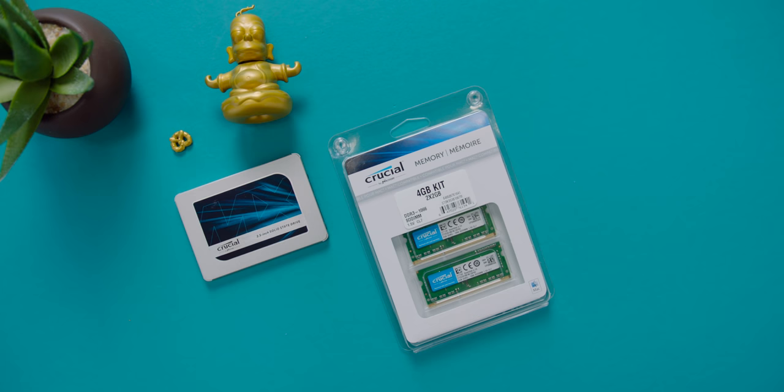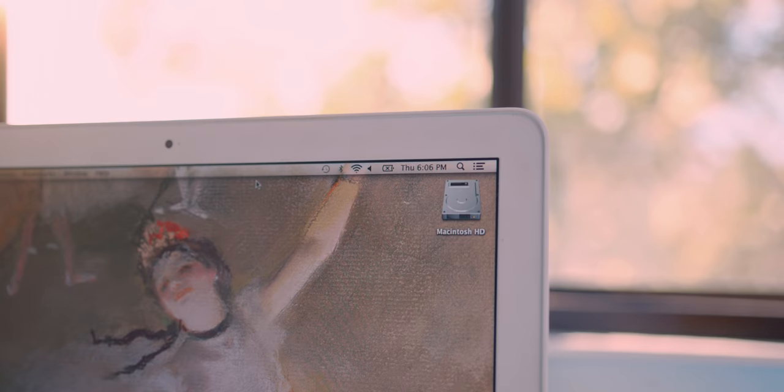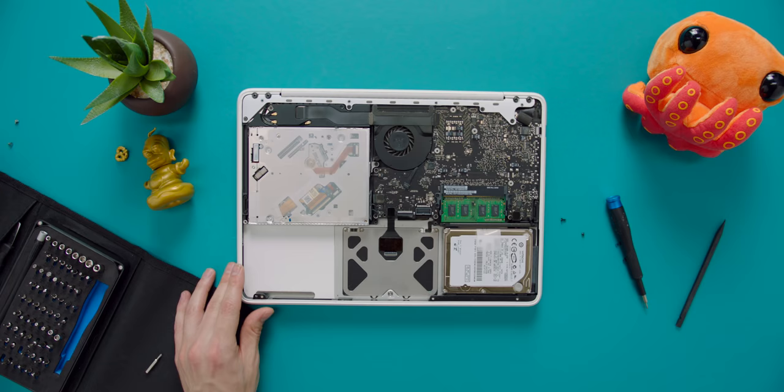I was a little nervous that the expanded battery might have damaged the keyboard or even the trackpad. So my first test was simply to plug in power without any battery and see if the trackpad and keyboard worked — and luckily, they did. From there, my first move was to replace the battery, which was super easy.